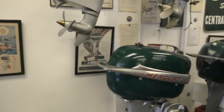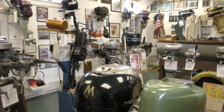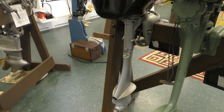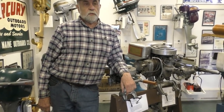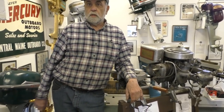Other manufacturers at that time struggled with a gear shift. The Martin had full-pivot reverse like the early Johnsons, and then they came out with the Martin 75 which had a neutral clutch, and the Martin 100 had a neutral clutch. But the Martin company never really came out with a full gear shift — there are rumors the Martin 200 had one, but I don't think anybody's ever seen one other than a prototype.